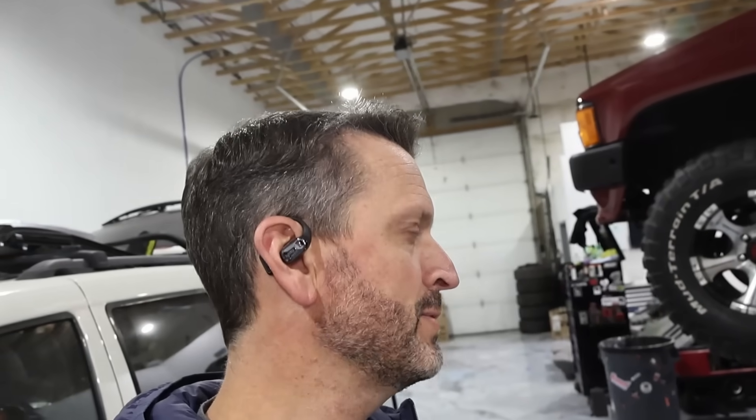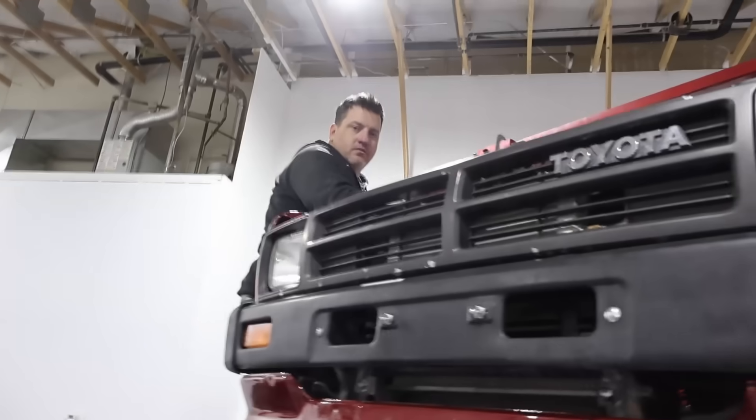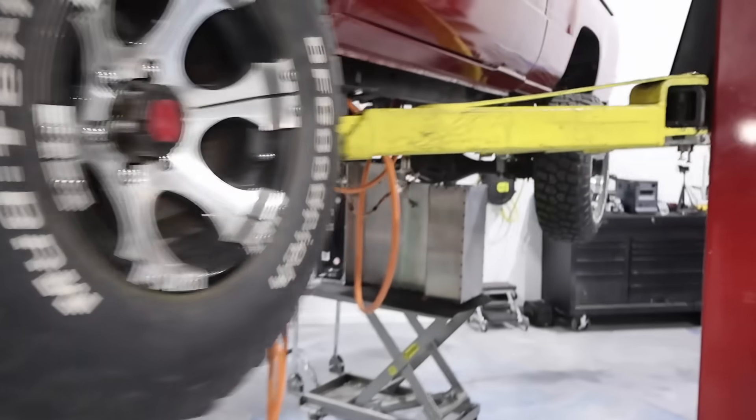The diagram for this pump is a little ambiguous. We did it what we thought was right, but it turns out we might need one more wire. This compressor is a little weird — instead of having a positive trigger to turn on the compressor, it wants a ground; you bring it to ground to trigger it. So we made a little wiring change and we're going for attempt number two.